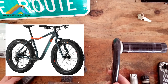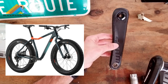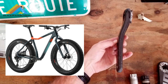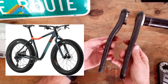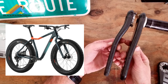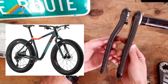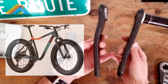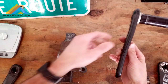Another thing: if you're wanting to put this on a mountain bike or a fat bike, you have to have the road version. If you look at the mountain bike crank arm, you can see the bend, and what it does is it throws your Q factor out way too wide. With the road version, you can see how straight it is compared to the mountain bike spindle. So if you're going to use this on a mountain bike or a fat bike, go with the straight road spindle.